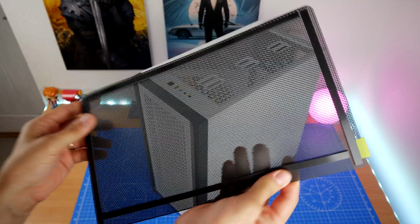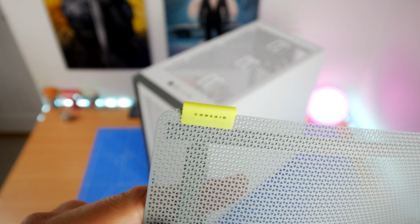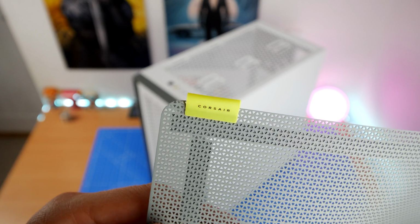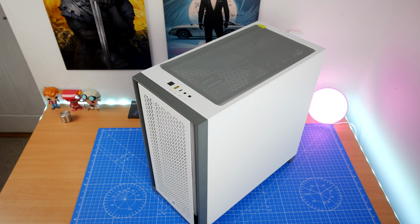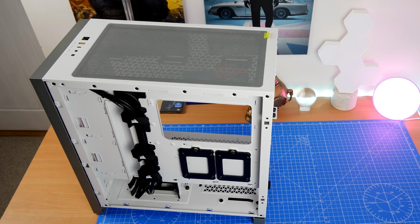It's worth noting that you can install a 240mm or 280mm radiator on the top there, a 360mm radiator on the front, or up to 6 120mm fans. Now, I'm going to leave all the specifications and other information in the description so you can check those out, as well as links to the other videos that will be relevant to you when you're watching this. But hopefully you'll find this video useful in highlighting the highlights and pitfalls of this case.